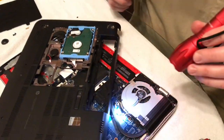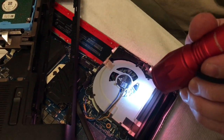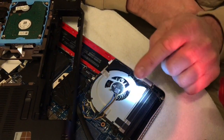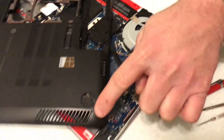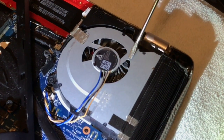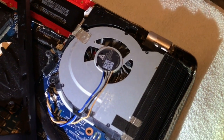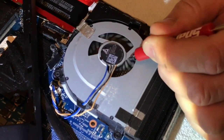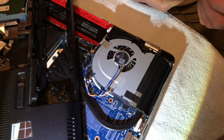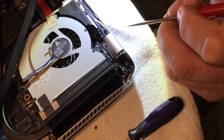We have accessed the fan on this unit — oh look at that big old dust ball right there! And there's a screw wedged in there — ain't that awesome! I think we found the problem. There was a screw we noticed was missing on this corner of the laptop when we started. That screw is wedged right in the fan. All we've got to do is get the screw out — we'll do that with a magnet. Yes! Look at that — and you can see how the fan moved and snapped right back into place. We're gonna put this laptop back together and I guarantee you this sucker is gonna work.